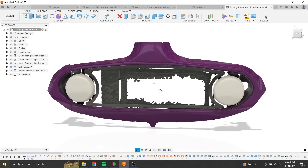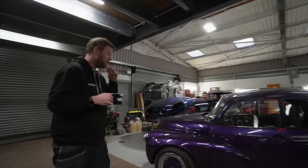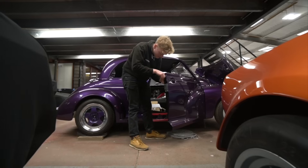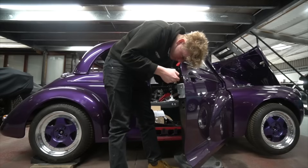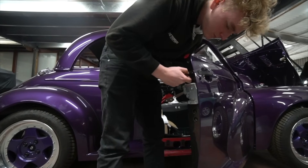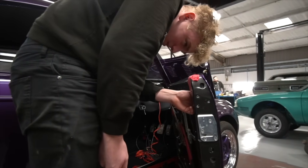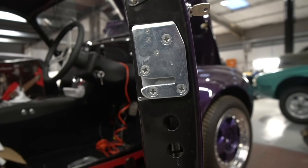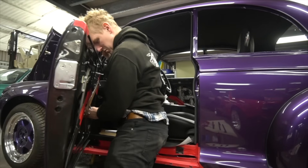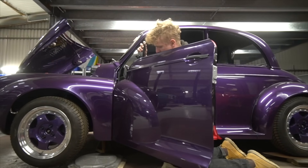Dean dropped the door cards off before Christmas - he's just got the rear bulkhead panel to do, and that buttons up the interior. George has been on with the door builds. We've finally got through the metal 3D printed parts - essentially a bit of the bolt inside the door which the new billet handles pivot on. They've also come back from anodising since last week, and that was the last piece of the puzzle. So George has the mounts in, handles in, mini lock mechanisms in, and central locking actuators in and connected. He's been getting the door frames in - these are billet parts we machined some time ago, just waiting for all the pieces to be in place.